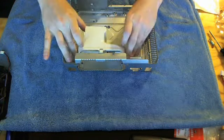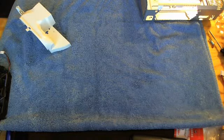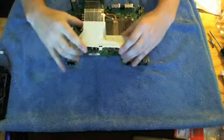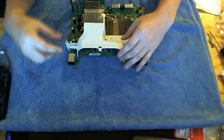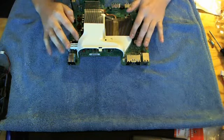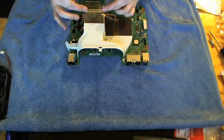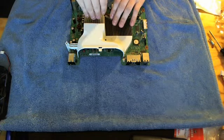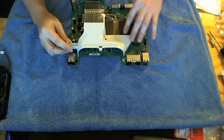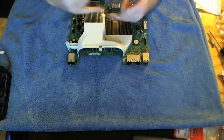This is the fan shroud that goes back with the fans. What it does is sit here and helps pull air across the heatsinks. The issue is that for it to work properly it should come all the way out to almost the front, because right now air just travels through and out the back, and this one is hardly even touching the processor. All the heat is right on this channel here.